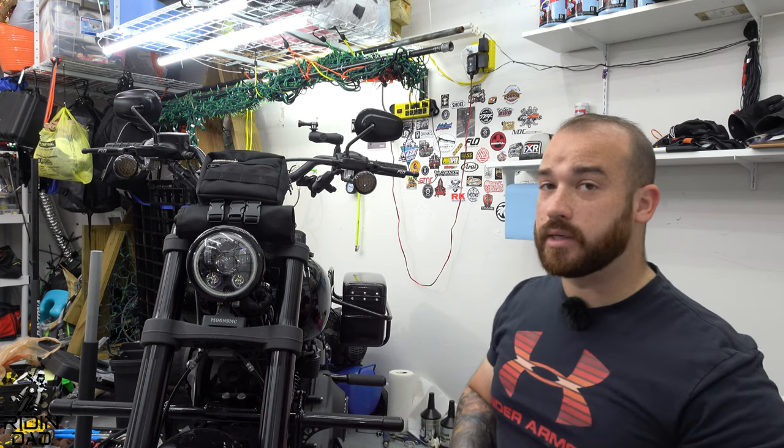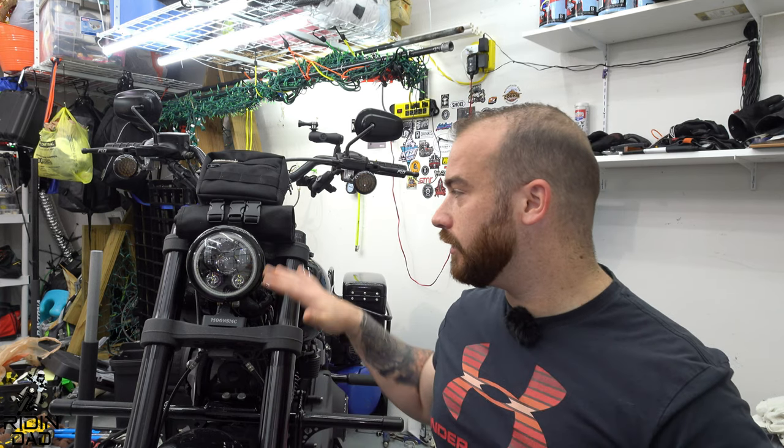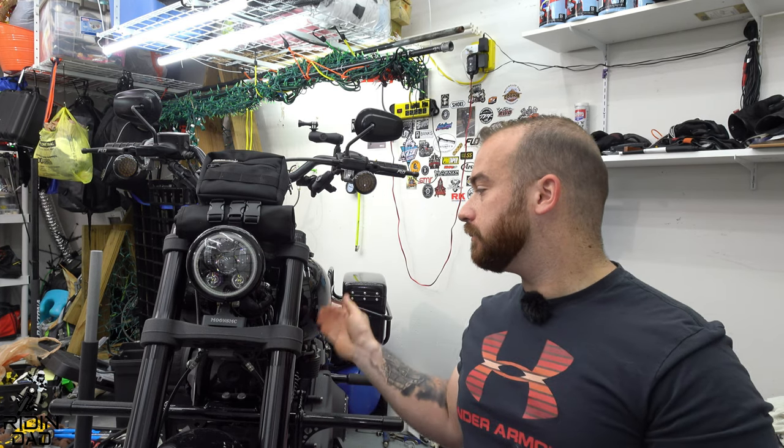A lot of you who follow my channel don't see me talk about or do torque specs for many things I do. This one is a very integral part of steering, and I don't want to have any issues with the threading in the tree mounts. So we're actually going to torque it down to spec. Per my manual, it says 16 to 20 foot-pounds of torque. I'm going to start around 14 to 15 on all of them and then go back up incrementally and see how they react. I might get all the way to 20, or I might only do 16 to 18, somewhere around there.